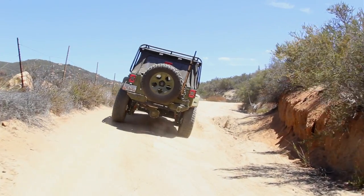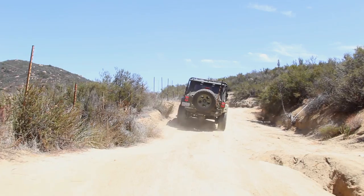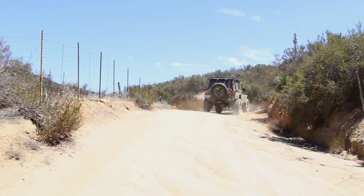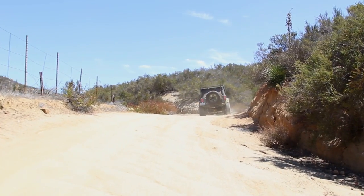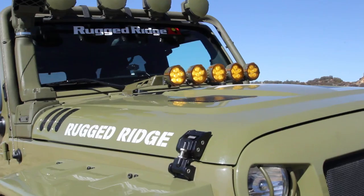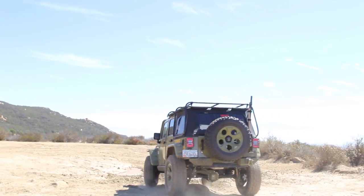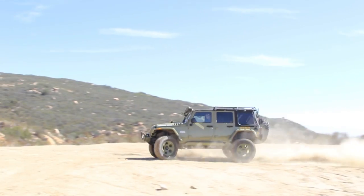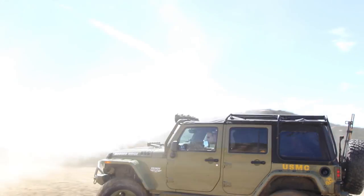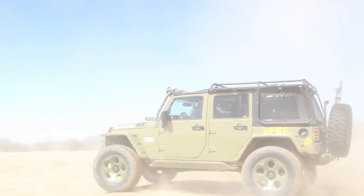You can have fun even at slow speeds in this thing. If you see a little jump, you goose it every now and then — it's fun. Jeeps are generally rear-wheel drive until you put them in four-wheel drive, so you can do donuts and burnouts too. It'll be hard on pavement with these big-ass tires, and Rugged Ridge hasn't really done anything to the engine. They've got a snorkel with a replaceable filter, and they've swapped the gearing to 5.13s, which means this thing actually moves nicely down the highway. I could cruise at 80 comfortably on the way out here.